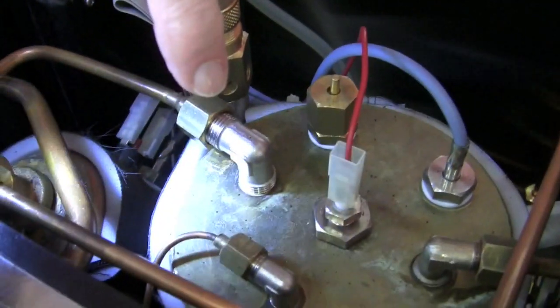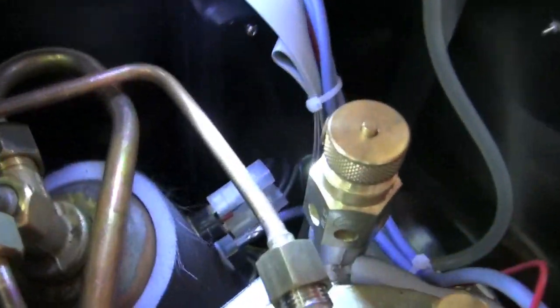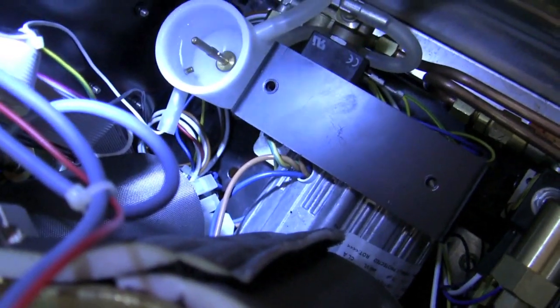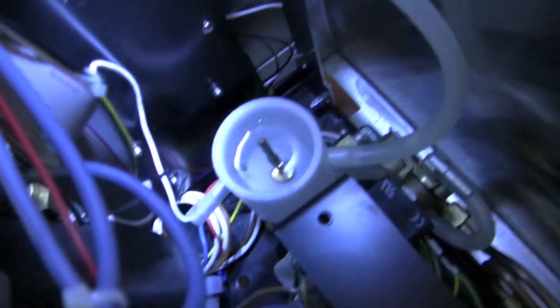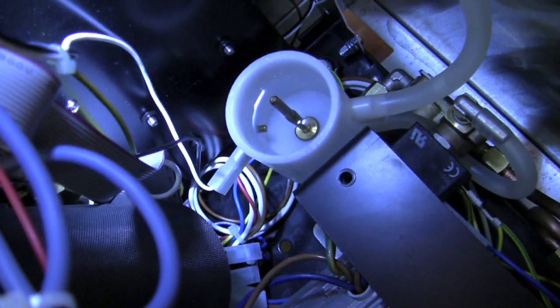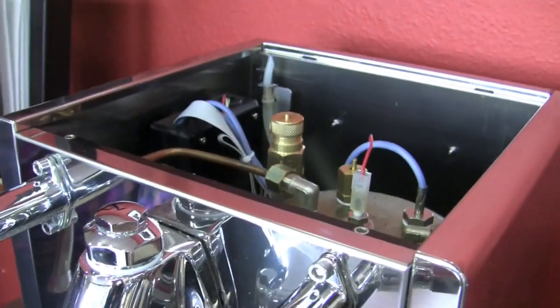You can see these are those brass end plates that the Rockets have. The rest of the boiler is copper — it's hard to see but you can see a bit of color. And there's your rotary pump — it's that big monster down there. Rotary pumps are much bigger. This is where the water from your water tank engages into the machine. There's a screw with an electric lead — that's where it detects minerals in the water. So if you're using distilled water, it will not detect any minerals and it will say, 'I don't have any water.' That's the inside of the R58.